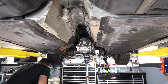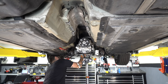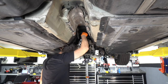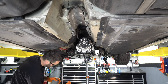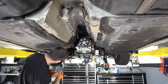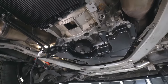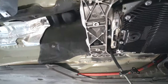Okay, let's get a couple of these bolts started. These bottom ones first, then I'm going to try and start these ones on the top. This plate has backing nuts, so you've got to put this plate in on this side. My battery died, but I did get the transmission all mounted in — all of the bell housing bolts are in and torqued, as well as the transmission mount.